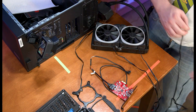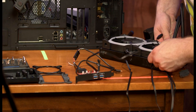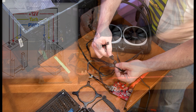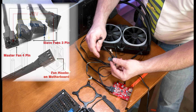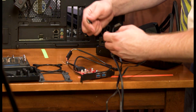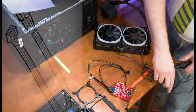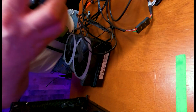That gives you a little header you can plug into, which will allow us to plug the RGB and fan controller in later. Now we're going to go back to the fans and plug in the RGB control wire that goes to the main head unit — the actual pump and heatsink. It's very important that the first fan you plug in is the one that has four pins; after that, the next fan can go to any of the other three-pin headers. Then we plug in the RGB control wire, which only fits in one way so you can't screw it up. Then bundle the wires to keep them out of the way.